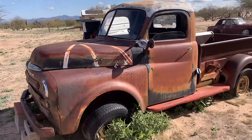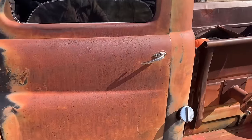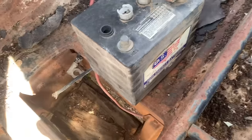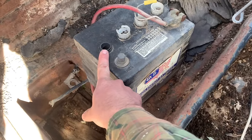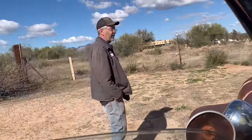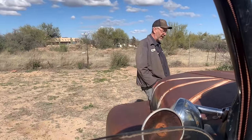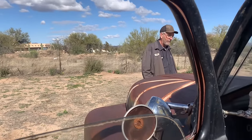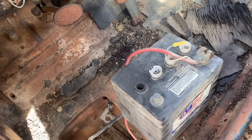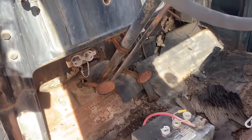It's cool — it's even still a six-volt system, never even converted it to 12 volts. And if you look in here you can see the battery. This is still a six-volt battery. Why is there four if it's a six-volt? Wouldn't they have had an eight-volt battery in it? Yeah, this is an eight-volt battery. They used to put eight-volt batteries in the six-volt cars because they get a little more cranking out of them. It won't blow the lights out. Each cap represents two volts — the six-volt has three caps.